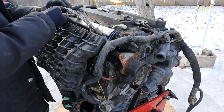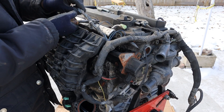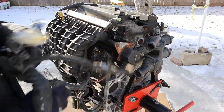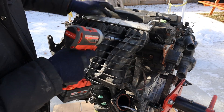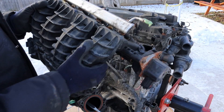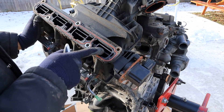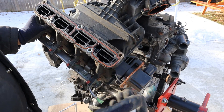This engine was apparently running when pulled, so I'm just going to go ahead and take off these wiring harnesses, making sure not to damage anything. Now I can work on removing this intake manifold — these are just a bunch of 13mm bolts. On the intake here you can see these little flaps controlled by an electric motor.